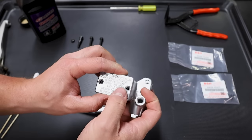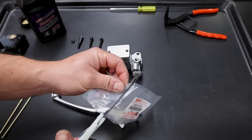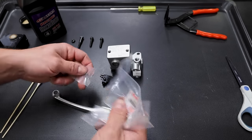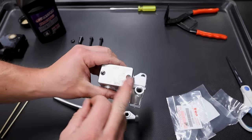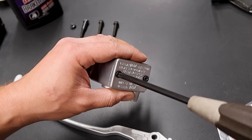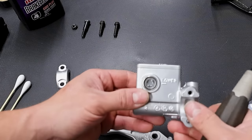Up top we've got our bladder and warning label cover. I chose vapor blasted aluminum instead of the original black - I think it's a cleaner look. The vapor blasted aluminum stays nice for a really long time. James at Moto Blast does a polishing finish that closes the pores of the aluminum - even machines left outside with mud and washing stay really nice. Putting in brand new factory screws and using a JIS (Japanese Industrial Standard) screwdriver. You definitely want JIS for Japanese bikes or else the screws get damaged and you have to drill them out.